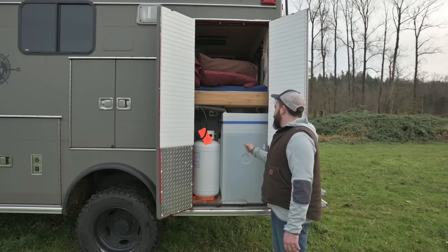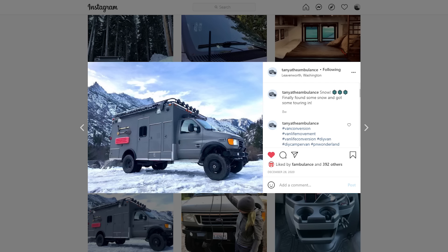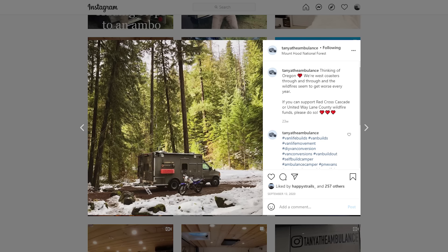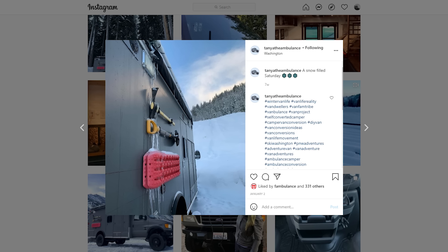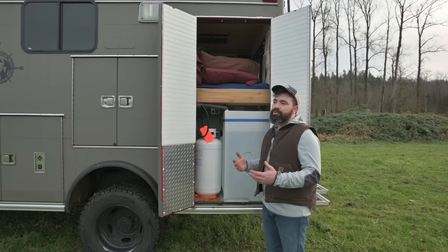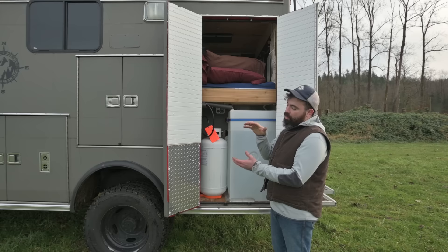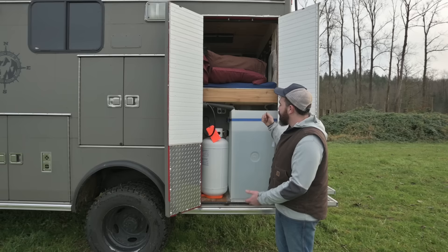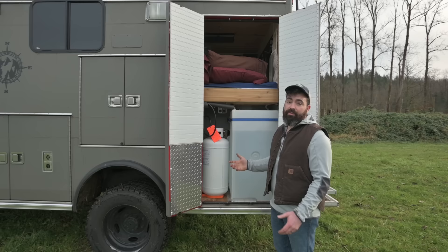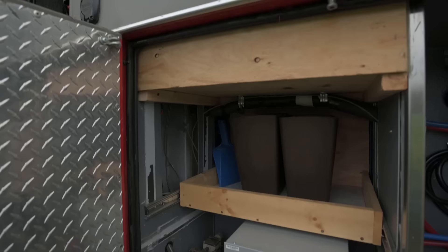We have a 45-pound propane tank inside — the biggest you can carry and still be able to get on ferries — and a 55-gallon fresh water tank. All of our water systems and water pumps we put on the inside of the body rather than running underneath, since we spend a lot of time where it's really cold and warm air is pulled through the cavities. When it gets really cold, we have a system with an irrigation timer — we set it to open for two minutes every two hours. That opens the valve, pumps the water through our entire system through the on-demand hot water heater, circulates it through the whole system and pumps it back. In really cold weather — like a couple degrees out — it pulls warm water all the way through our system and keeps the water right at about 55-60 degrees, so everything stays from freezing up even if we leave the ambulance.